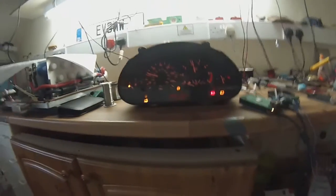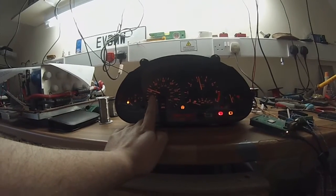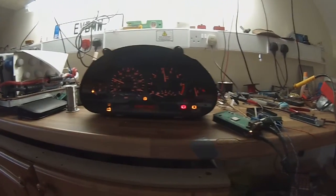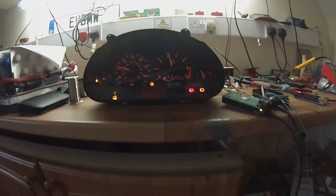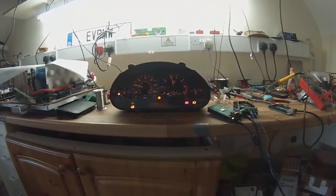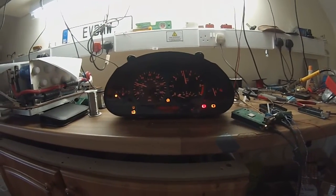So basically we can also send commands over the CAN bus. Now that we have the speedometer signal valid, we can send signals to the MPG meter. That's a rate of change of 2 values. I'm going to put a link in the description to a guy's blog that's been doing a lot of work with the E46 instrument clusters and other BMW instrument clusters. They were using these little CAN bus shields from SparkFun, but I got more used to the Due based ones when I was working on some of the CHAdeMO stuff last year, so I just copied the messages across and put them in there, and as you can see, it's working quite well. I'll just turn off the bench light here.